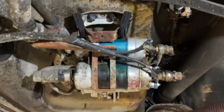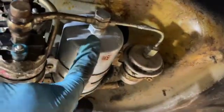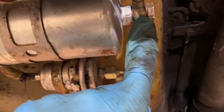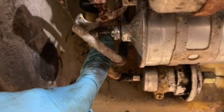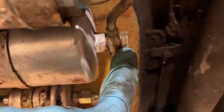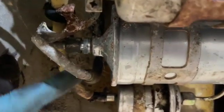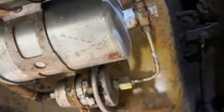Once we're under the car, we can see the mounting for the fuel pump — this is pretty gross. We've got the fuel pumps, the fuel accumulator, and the fuel filter right there. This is going to be fastened with a banjo bolt, and back here with a captive nut. Note that there are some copper washers, so make sure you have some to put back — those are one-time use. This one should be fitted on your new part, but there are three in total, so make sure you have those available.